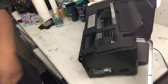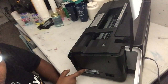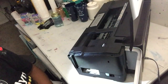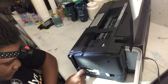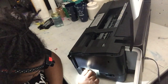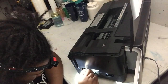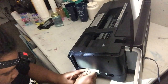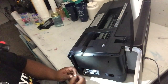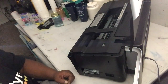Once you get your panel off, you open it up and it's gonna be two waste lines — that's what these two are right here. First thing you want to do when you see these two waste lines: each one is gonna have a clip on it. You kind of just want to squeeze that clip and scoot it back on the line — on each line, just pull the clip back so it's not securing the line anymore.